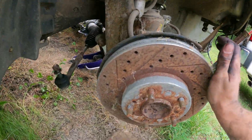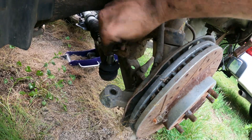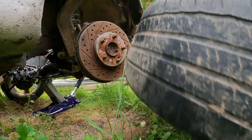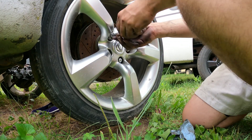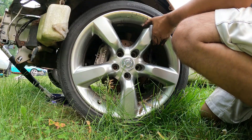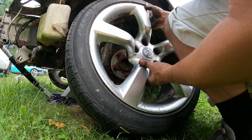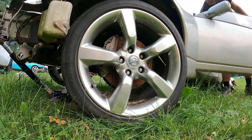With our wheels off, all we got to do down here on both sides is bend our tie rod over, take this castle nut and washer off of the tie rod, and place it up within the knuckle. We're just going to tighten it snug — we're not going to torque it, it's just to move the car around. Now the wheel turns! Except we've got to figure out our shift lock issue that's keeping the key in the ignition and keeping us from pulling it out.